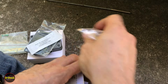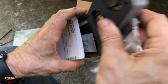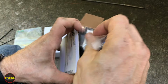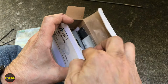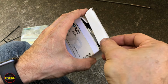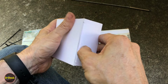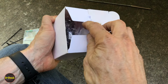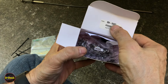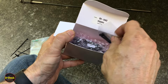Now, like I mentioned before, GM stopped using the Stanadynes when they went from black to gray, and they went with the aftermarket version from Flight Systems. And Flight Systems is gone now, too. They sold out to Dorman. Flight Systems was an aviation company. They had a division called, I think, DTEC that did diesel engine stuff. So here's what we're going to put on here, which is a white label version of a Dorman 904-104XD made in the USA. You get four screws with this one.